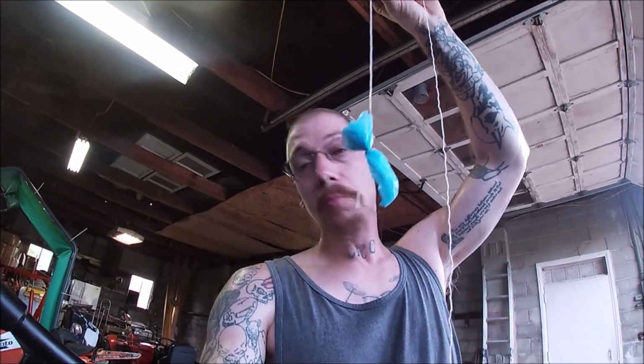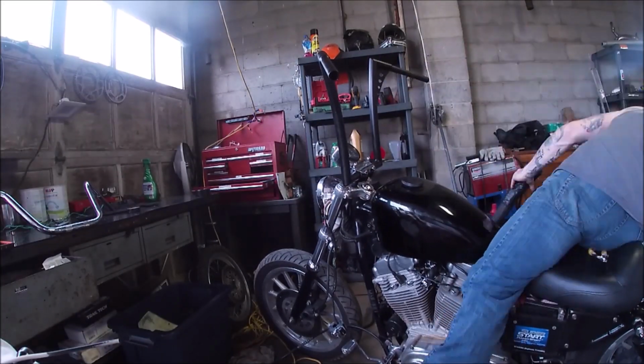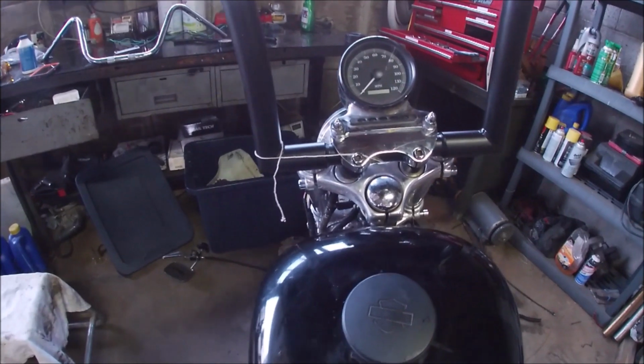So what we're going to do, taking it back to our construction days, we're going to suck this through the pipe, essentially, with a vacuum. That way we have full string, attach the wires to the other side of the string and pull them through. That's it. Nothing to it.